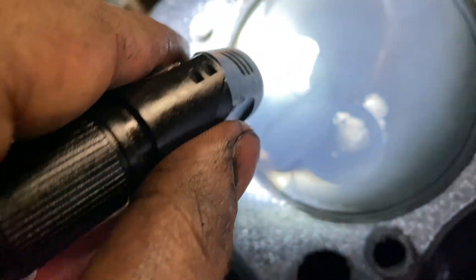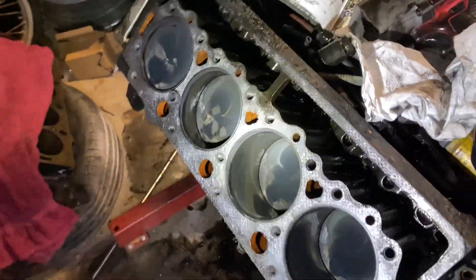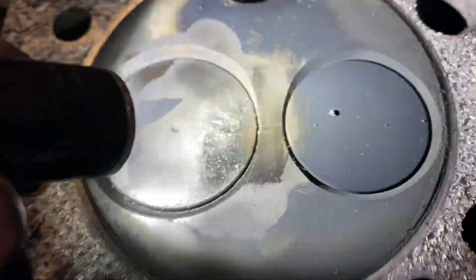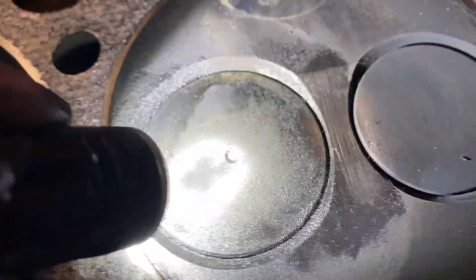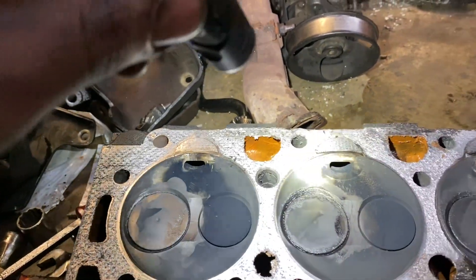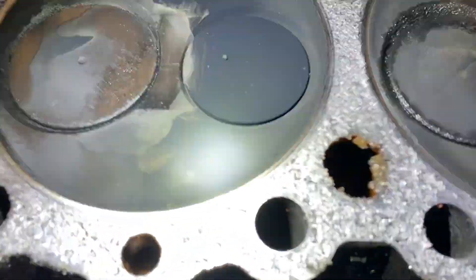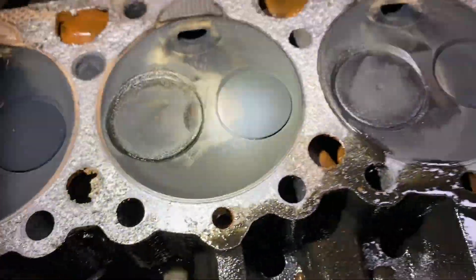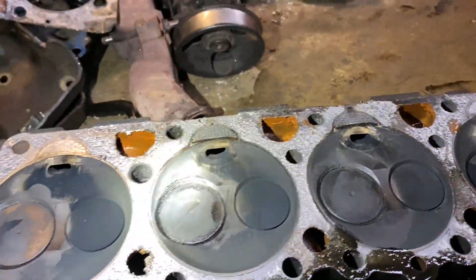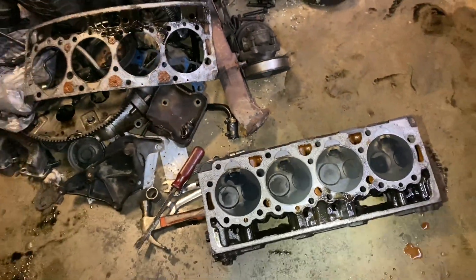Obviously I can check them out better. This one might be — I'll have to clean them up, pull them out, and check them later. On our head here, this side is cracked. Both the inner two don't appear to be cracked. Both the outer ones are cracked, right there in between the valves — that's very common on these also. I don't really see any spots where the head gasket failed. It's a little clean right there, but you'd see black marks most likely where the exhaust gas was passing through. So we'll pull the other side and see what we can find there.